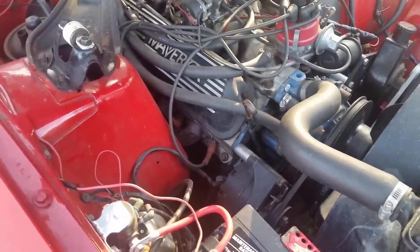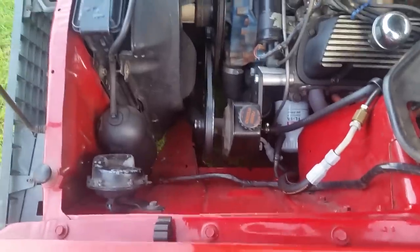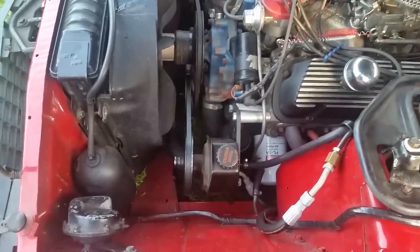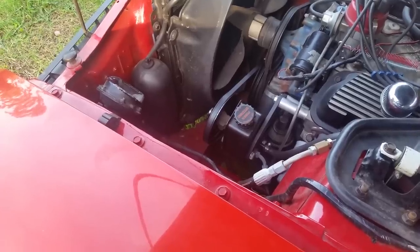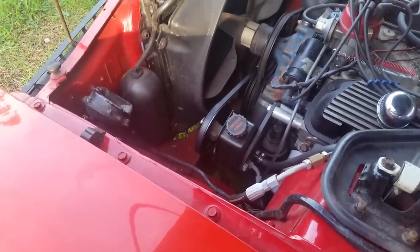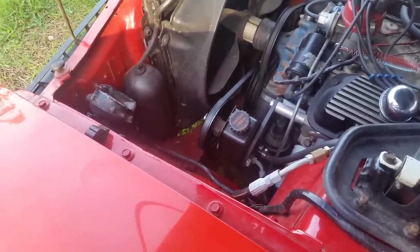I've taken Scotty's advice — I have all the parts. This car used to be a power steering car, but about 20 years ago I took it off because it was that old external power steering that dragged and leaked. Well, I'm getting older now and I needed power steering. There are wonderful kits that use Saginaw integrated power steering, right in the power steering box. So you Ford guys will notice that looks like a Chevy power steering pump — and it is a Saginaw pump, which Chevy uses.